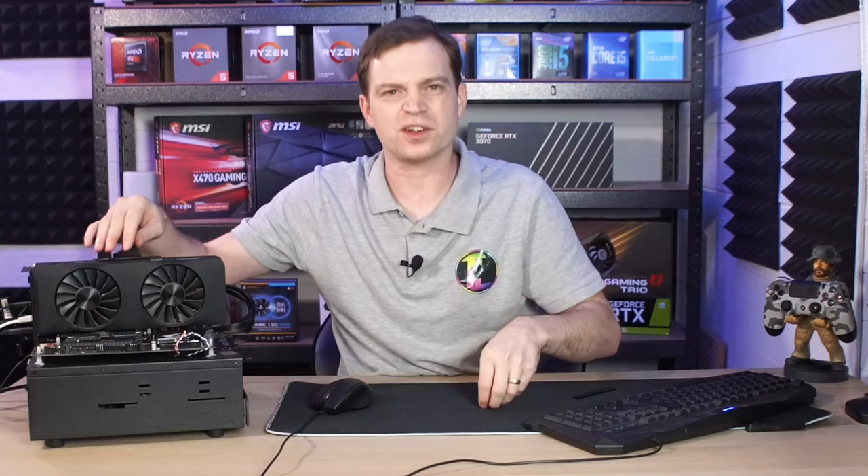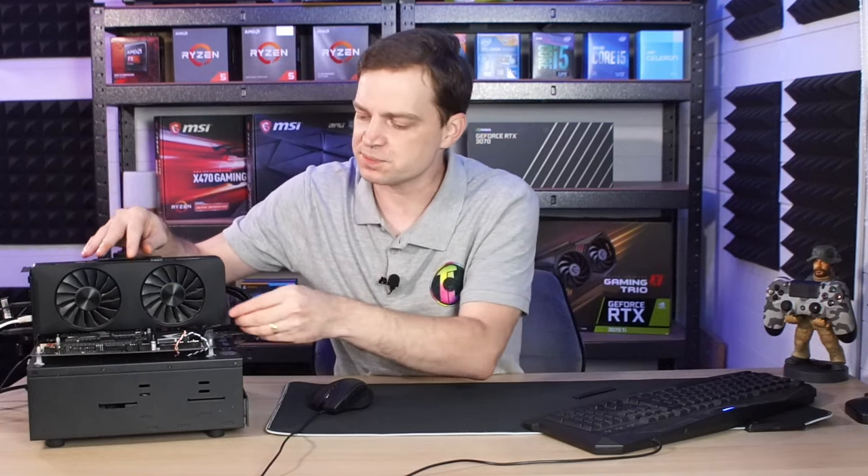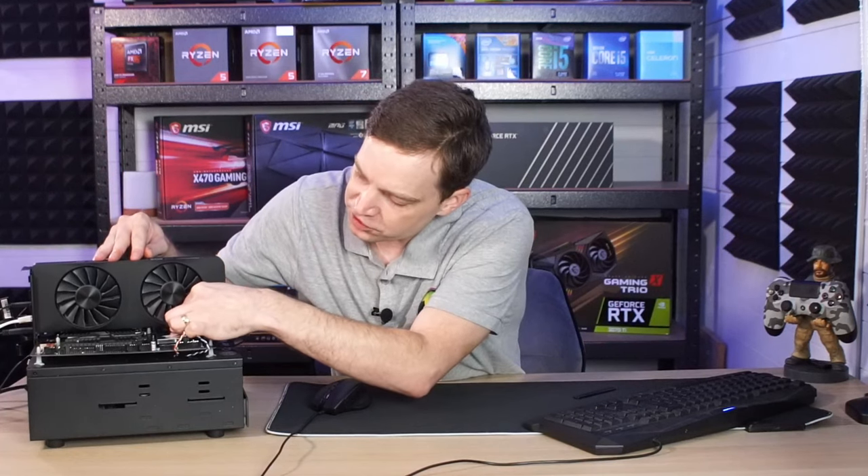On this test bench I find cards tend to rock forward slightly, so I'll stick a little rubber piece underneath the front to hold the card up nice and square. The card will need power, so we'll get that connected up along with the HDMI, and then we'll see if it boots. From my research these cards are suitable for a 550-watt power supply, which is exactly what we have. We're running off the pigtails, but it shouldn't be a problem given what we're planning to do today.